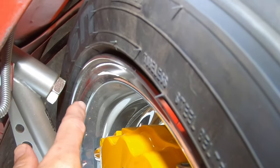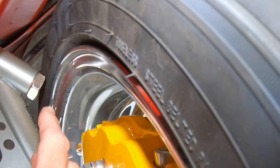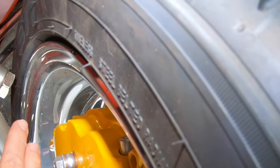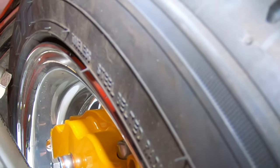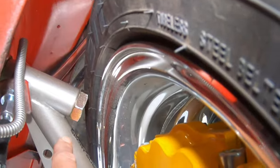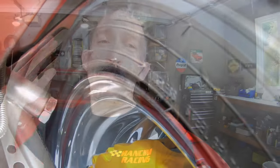So that is the problem. To answer some of your questions on wheel specs, these front wheels are five and a quarter inches of backspacing. It's a little more than what most people run, but I'm sure it wouldn't hit at five inches, which is probably the most standard aggressive backspacing most people do. But I know some people run five and a quarter and it works okay, but with this upper control arm and this big adjusting nut feature, it is going to hit at full lock. So that's not going to work.